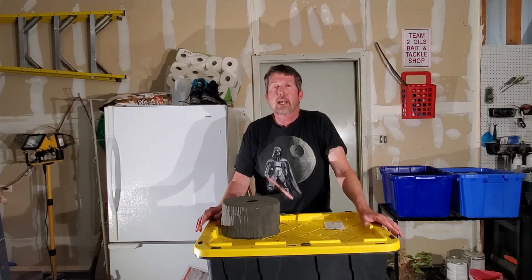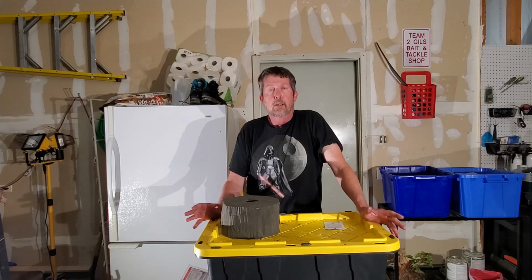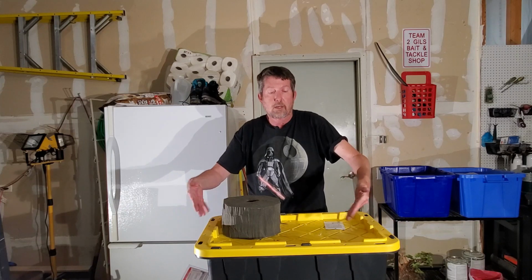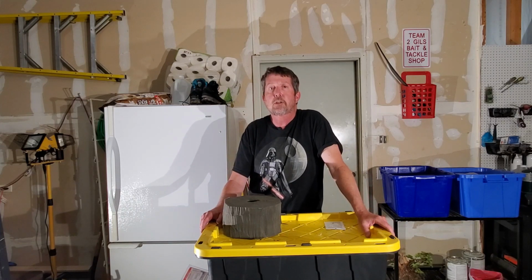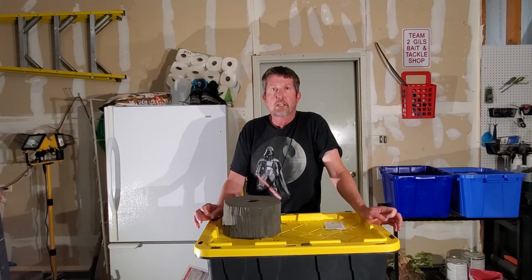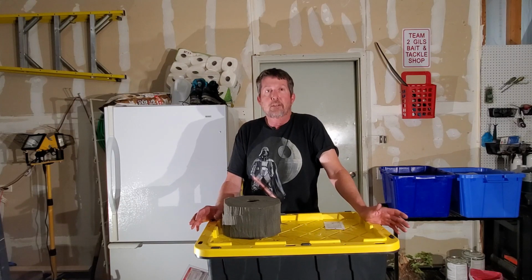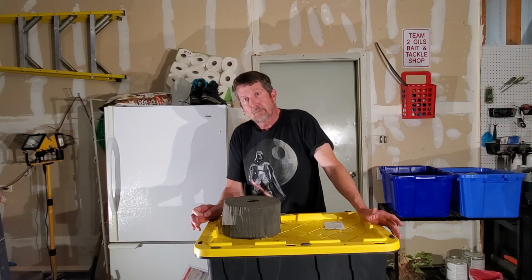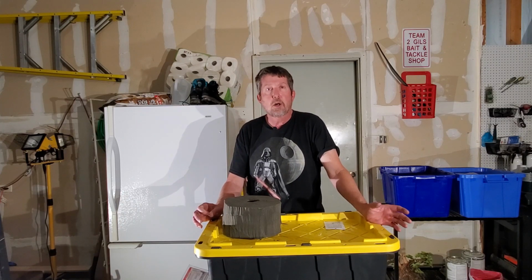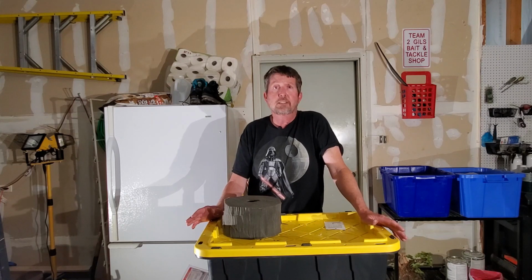So if you're adjusting your caster, you want to recheck your toe-in and those kinds of things. Especially your camber, side to side, you're going to want to readjust your toe-in. Each one can have a little impact on the others. So make one adjustment at a time. Go out and test ride it. Is it better? Is it not? If it is, that's good. Maybe make another adjustment. Now is the new adjustment better than the old one? Just keep doing that, small things at a time. A lot of times for me, it's difficult to tell if it's better.